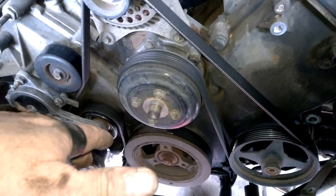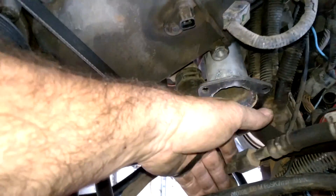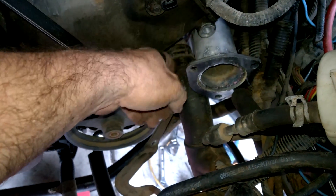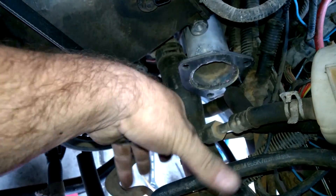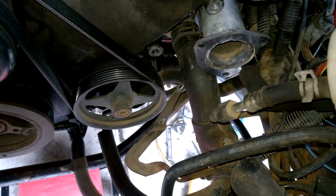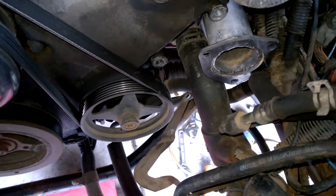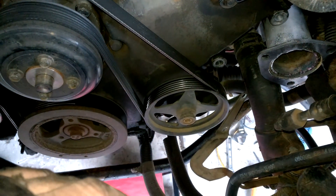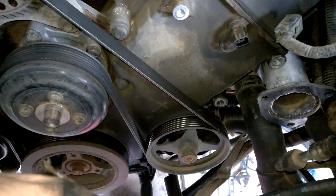This is gonna have to be a pretty sharp turn right here when I make this pipe — I probably should have had it about a half inch back, but I wanted to be able to get to the bolts. I'll have to modify one of the elbows or just use straight pipe, cut it and weld it to make the radius. You can't readily buy a bend that tight. I made real short radius turns on my Dakota when I put dual exhaust on it — they don't make kits for that because it's not real roomy, and because of the front driveshaft, I brought both pipes over to the passenger side.